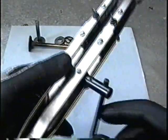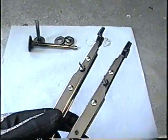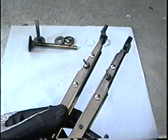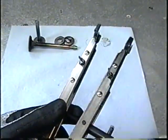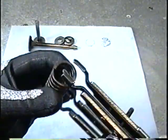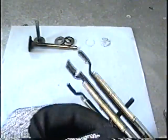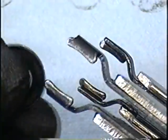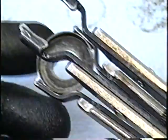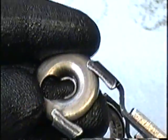This lever here is to open up the tool or close it in. So when it's time to put your valves in, you would put the spring in like that, and then set your adjustments accordingly. Before you install the valve, you want to set the gap of these caps that go on top of the spring to fit inside the tool. I've got them set.